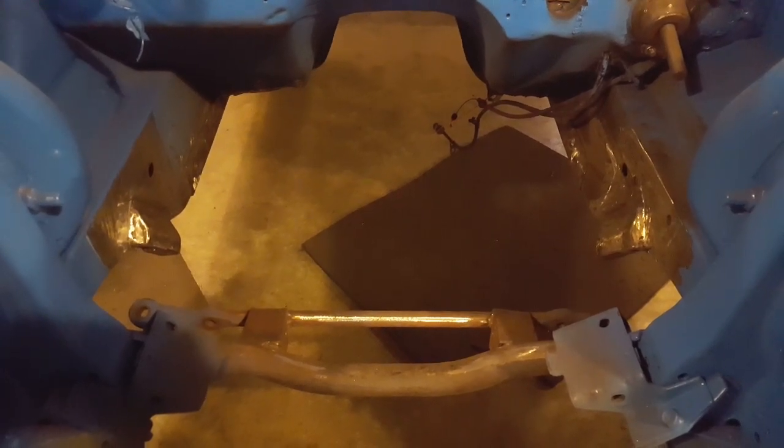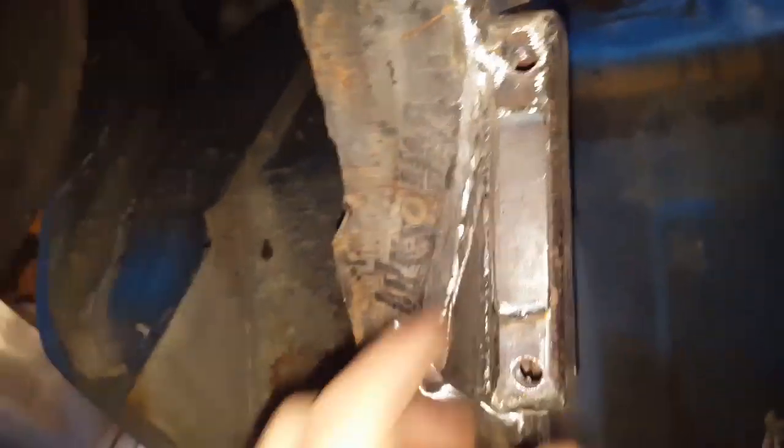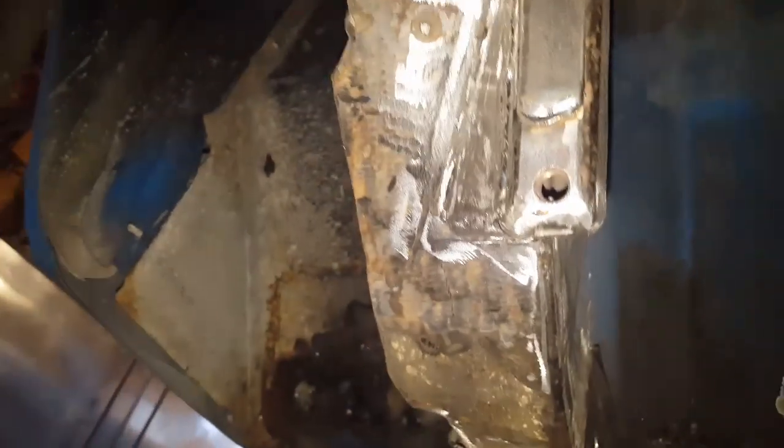Here you go - there's the brackets. You can see I got them diagonally put in across here. This is 3/16 plate on top of 3/16 plate, and over here is 3/16 plate, and it's all welded to the frame rails. I had to put a spacer on this side to tighten up the bushing, but you can see now I can just bolt them in place nice and tidy.